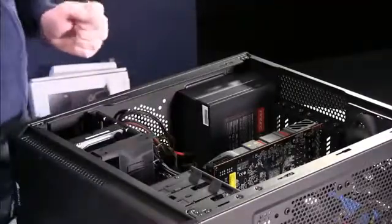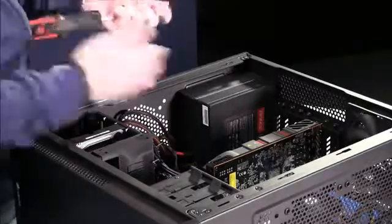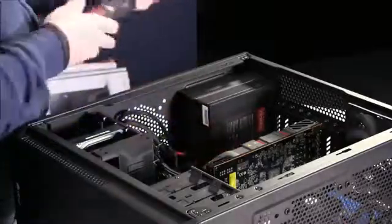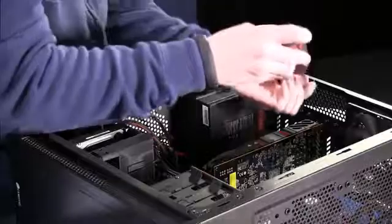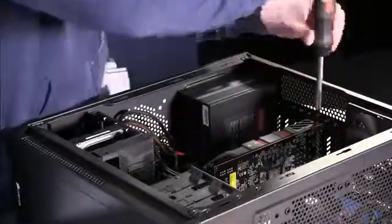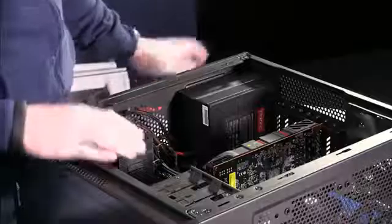This motherboard, and I think a lot of motherboards in this form factor, will support multiple graphics cards. If you want to do that, you know, check your motherboard for the best layout, but you've got 3 other PCI Express slots that they could fit in, and there's obviously one that's going to be the best option for that. Multi-GPU is a more advanced option for PC gamers, but I think once you figure out what you're doing, it won't take very long until you're going to want to install a second GPU anyway.